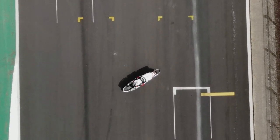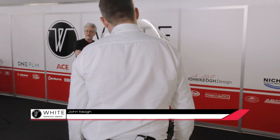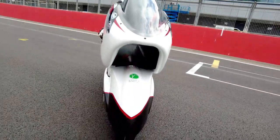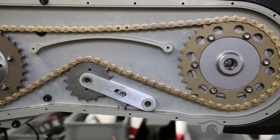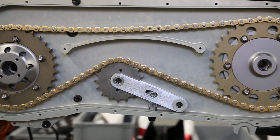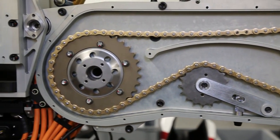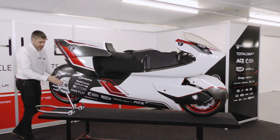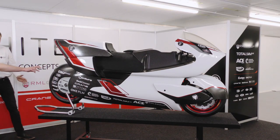From plan view, the top, it's like a fish — it smooths down to a tail. It doesn't need an extended tail because we can fill that with the exit of the venturi. We engineered the bike so that even at the very rear of the motorcycle we've managed to put the entire drivetrain inside the left hand side, and that means we've managed to reduce the width of the rear swing arm to the hub by four inches — 100 mil.